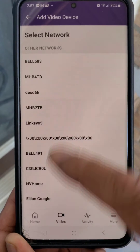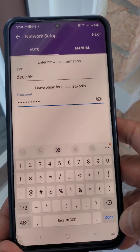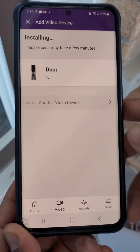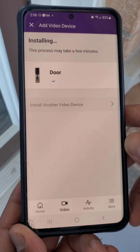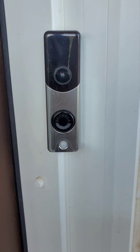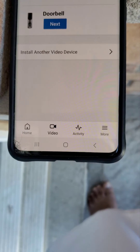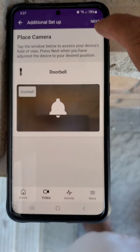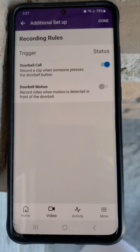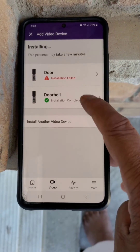Go back to the app. It's now looking for the Wi-Fi in your house, so click scan and connect to your home Wi-Fi. Enter the Wi-Fi name and click done. The installation may take three to five minutes — it will show a percentage of progress. Your doorbell will blink different lights during this process, which is fine. Once complete, click next through the prompts, turn on doorbell motion if you'd like, and click done.